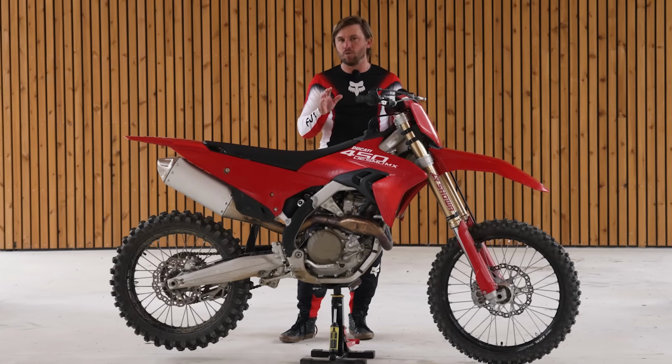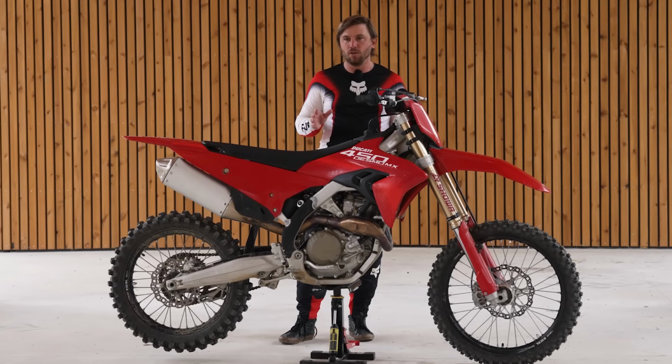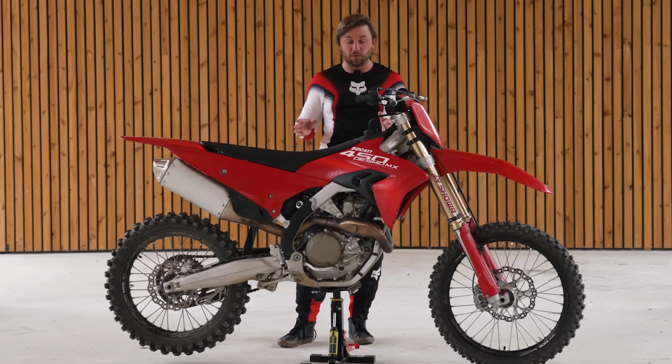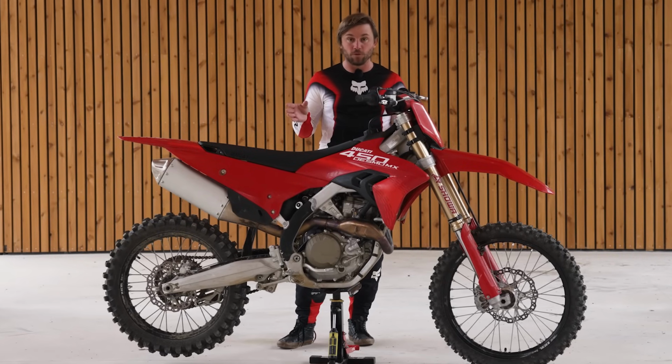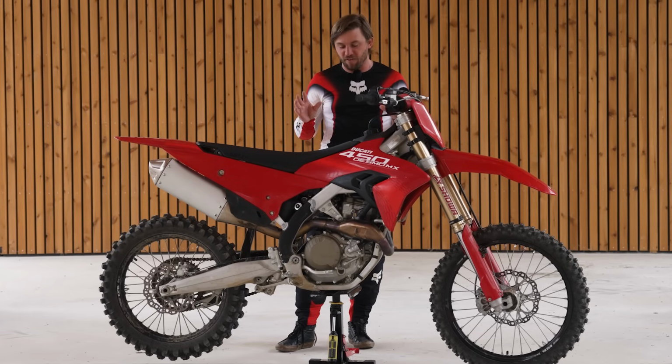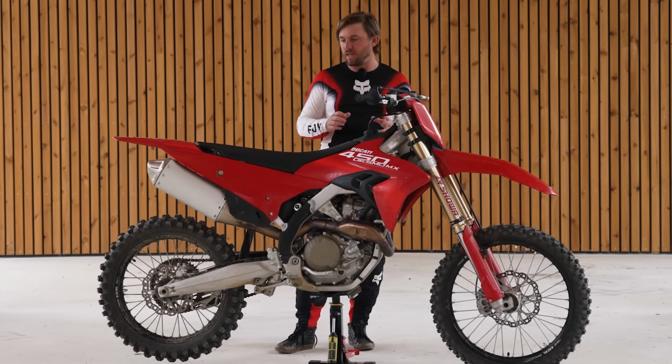I feel like that's a current struggle. Some bikes, you put input on them and it's almost too much. One or two millimeters of fork height or one or two millimeters of sag goes good, and then one more goes basically right off the cliff. So effective, but not too sensitive on that end.